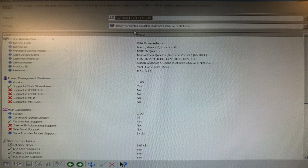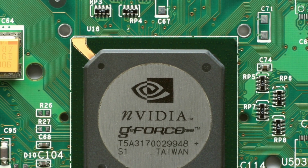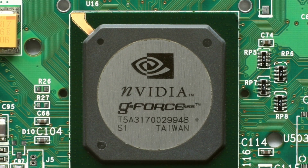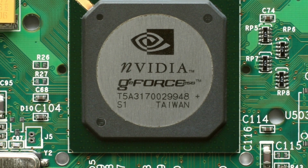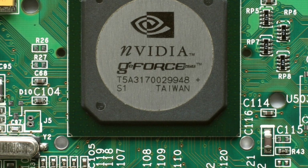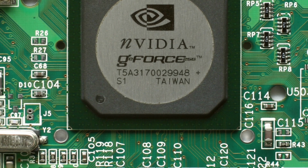This is also the reason the Nvidia Quadro was equipped with this machine, which, according to my research, provided better graphics capabilities for CAD and other uses. While mostly identical to the contemporary GeForce 256, the Quadro has additional hardware support for high-end graphics design and also received a certification from certain suppliers to go along with their graphics products. Still, if it is a GeForce 256 at its heart, the interesting question is how well it would stack up if I compared the two systems.